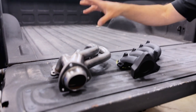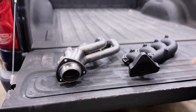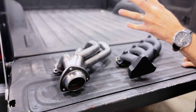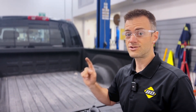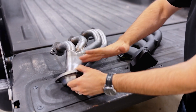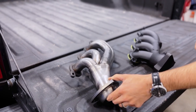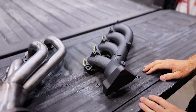I think there's a bit of a misnomer in the scene — a lot of people maybe think that these shorty headers are great. Opinions are mixed on the shorty header. Some guys automatically group it in with the performance of long tube headers because it's a header. But many people, if you cruise around the internet and do a little research, correctly say that these are not better than just factory manifolds and in many cases sometimes worse. But just looking at them here on the bench, you can see a shorty header gets a little crunched up because there isn't a lot of space between the flange and the outlet versus a cast manifold.